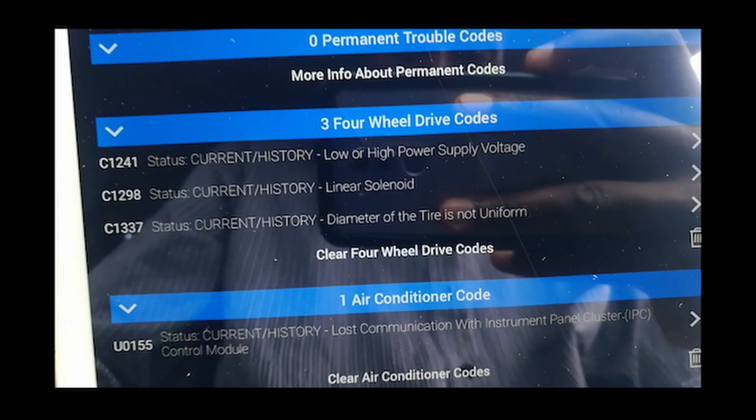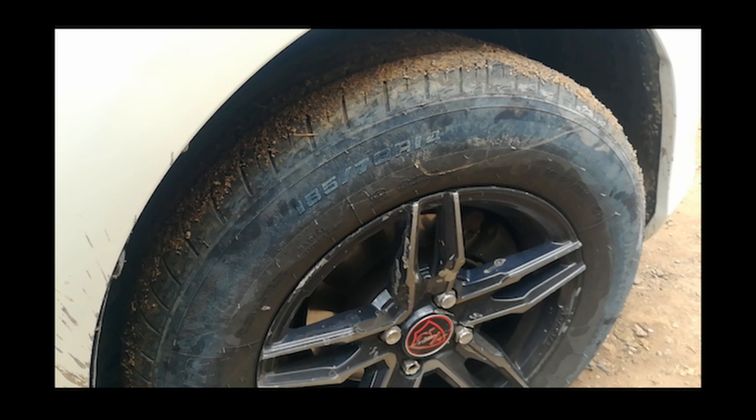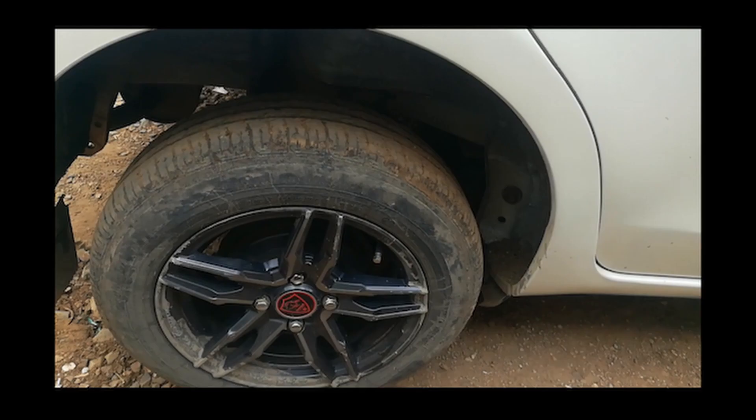When you hook your scanning tool to it, you'll get the code. The danger with this is that when the vehicle is in four-wheel mode and the wheels are moving at different speeds, your transmission system will be damaged. You may end up with a huge bill to replace your four-wheel or transmission system. Some people do this because they want to save money — buying the front wheels first or the rear wheels first and then buying the other set later when they get the money. That leads to this problem and it's a danger. So you should get all four wheels of the same size.